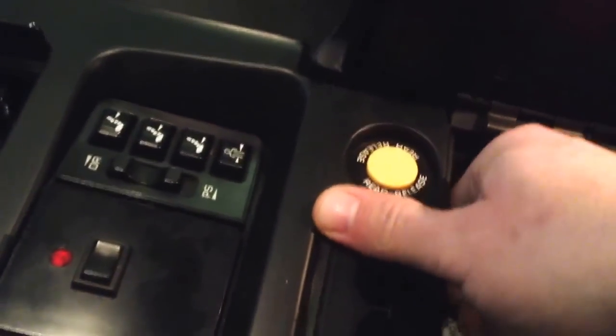Now I've taken the three screws out that we've talked about, but if you look at it, it's actually quite loose — almost ready to come out. What you have to do is just take off the door, because you'll notice part of the center console actually just clips and hangs up on the door. So once we take off this door, it'll pull right out. I've undone those three screws. It does hang up on the center console, so there are also four screws right along there — one, two, three, four. Once you undo those, you can see it'll come right up. This piece of plastic is what was hooking onto the center console.